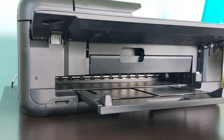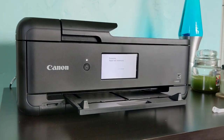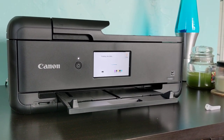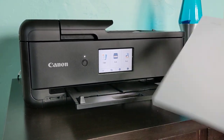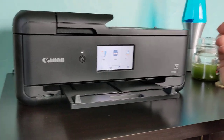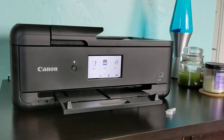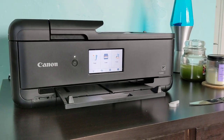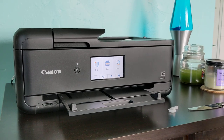Get that out of there, and now we can close it, tell it okay, and it completely prints with the panel closed — no problem printing it out. So if this is something that annoys you with the Canon PIXMA devices, where it makes you keep the operation panel open to print and you don't like that, go in there, remove this item with a common butter knife, and now you can print to your heart's content with the panel closed. Quick and easy!